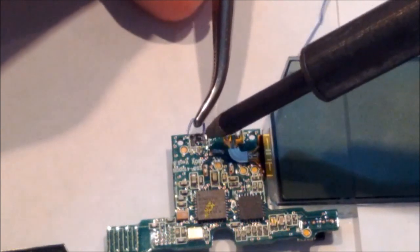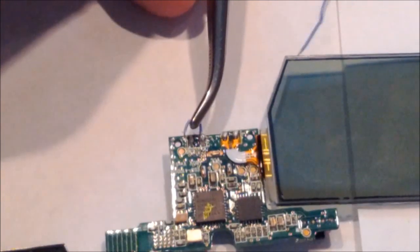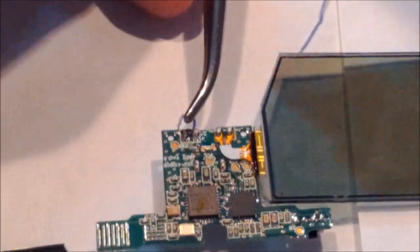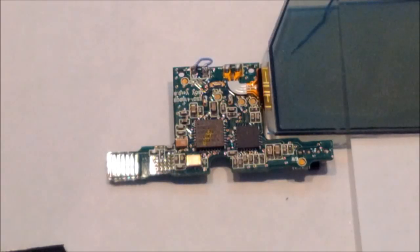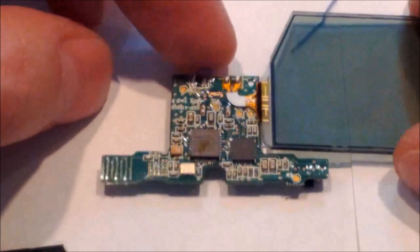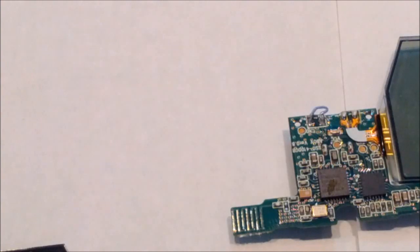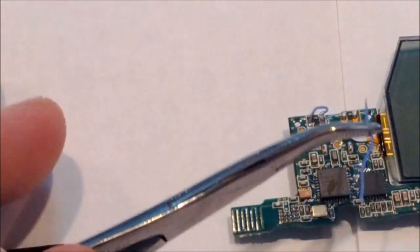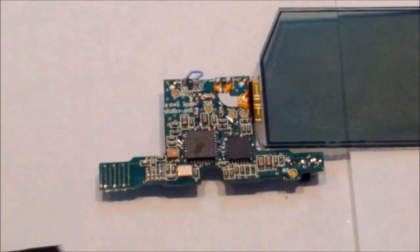You'll know this because when you turn on the glasses, the light will flash back and forth, just red and green. So using the solder that's already there, I solder one side to it, and then I solder the other side to the other connection. It's pretty strong. There's enough residual solder there, you don't really need to use yours much. It's only if you end up taking too much off, you may want to add a little solder to the connection and then stick your pieces in there. But I do the entire build without using my solder one time.